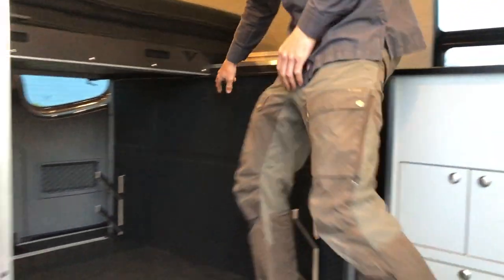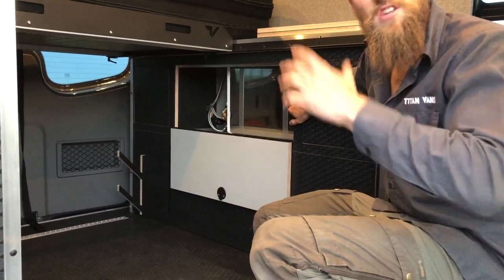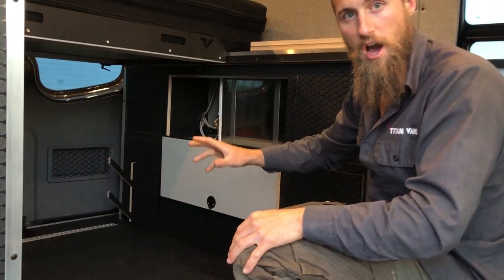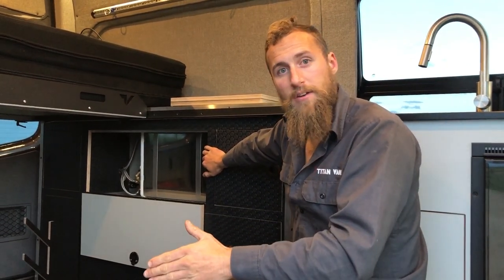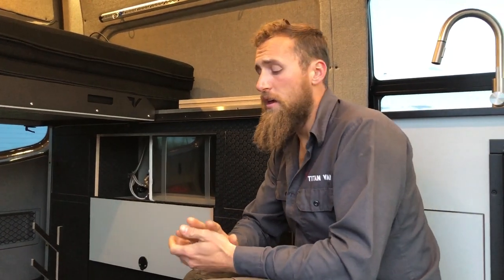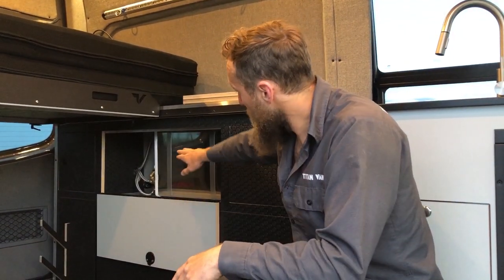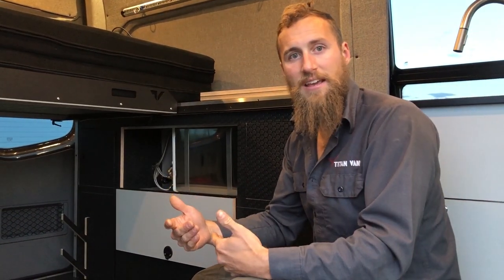This first cabinet is empty storage — food, pots and pans, clothing, whatever you need. On this rig we've added a hot water heater, which is an upgrade package, plug-and-play. All the plumbing is pre-run and holes are cut in all our classics whether or not you add the hot water heater, so it can be added later with minimal effort. It's an electric hot water heater that runs off the inverter — the battery's 12V DC is converted to 120V AC to power it. The heater is four gallons and heats water to about 185°F — way hotter than you'd want at the faucet. A built-in pre-mixing valve blends cold water with that hot water, stretching four gallons to six to eight gallons depending on your comfort level.